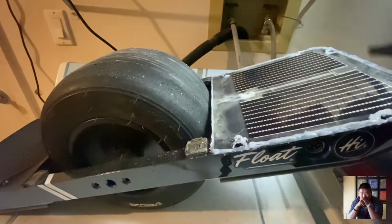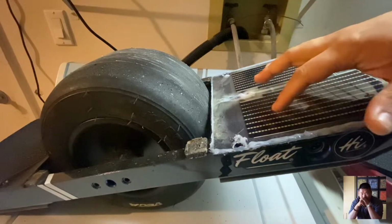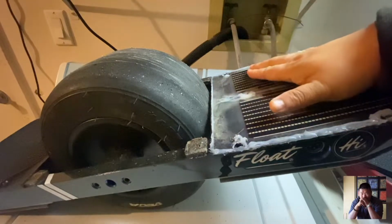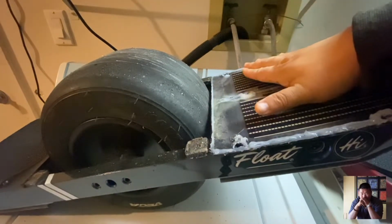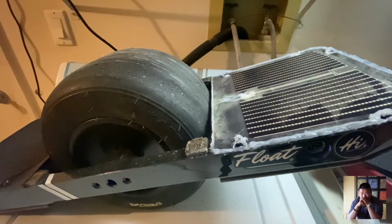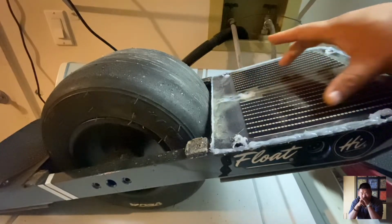I also think it's possible to use a standard front foot pad, or a standard rear foot pad, using this method with just adding another bead of silicone here and here, or some kind of double-sided tape. So if you take, say, the stock foot pad, and I have one somewhere, not with me right now, but let's say you take a rigid foot pad that will not flex, just putting the weight down should engage it onto this transplanted sensor. So you should still be able to get your heel side, toe side activations and disengagements as well. I'm just not completely certain if it will happen or not. Theoretically, it should work, depending on how you put your contact strips to engage the sensor.